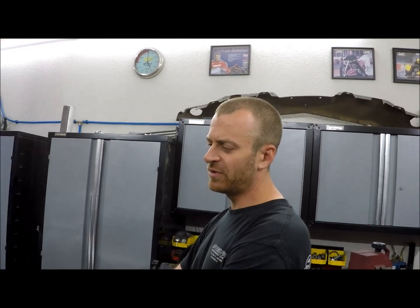Technically it clears. Our tightest point is the hood, and our clearance is about 5/1000ths of an inch. So basically none. It doesn't interfere. You can close the hood gently, but it's way too tight. So the solution for that, actually, I can't bring the motor down any more than it is.